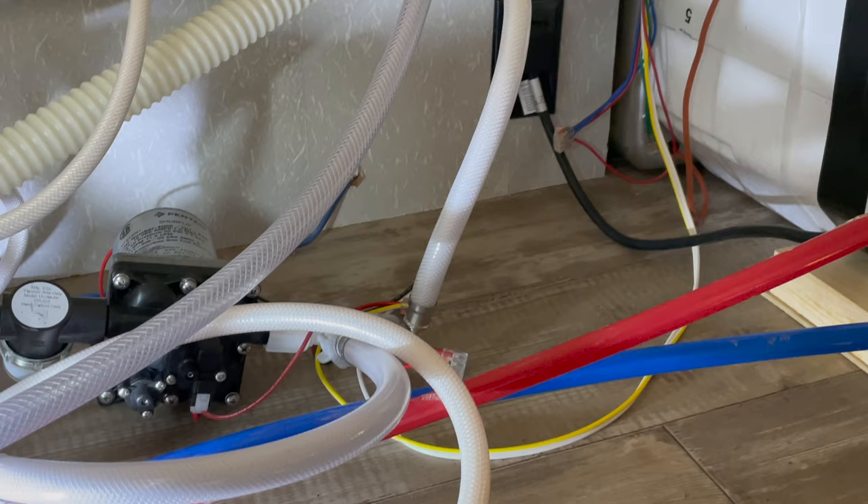So that's it. It's a quick maybe 10-minute installation - basically the tubing, some hose clamps, and some sealer foam, and your problem is solved. You'll be able to fill your tanks up completely. One potential issue I noticed: if you fill your tank to where that little elbow is and you don't have the hose run up to the vent, you have the potential for a siphoning effect. You'll think your tank is full, drive off, and suddenly have half the water you thought you had. I'm pretty sure most of the Wolfpups are like this. If you have any questions, let me know.